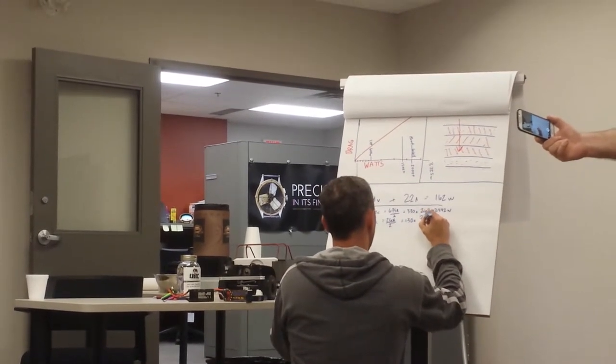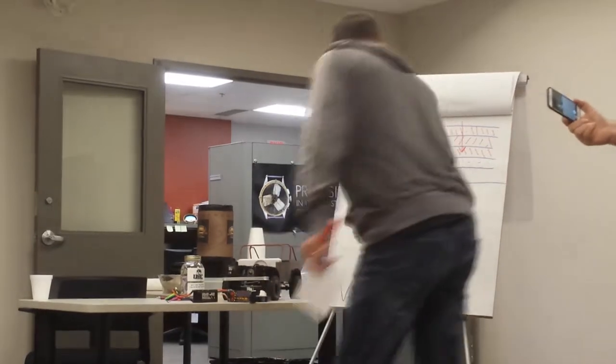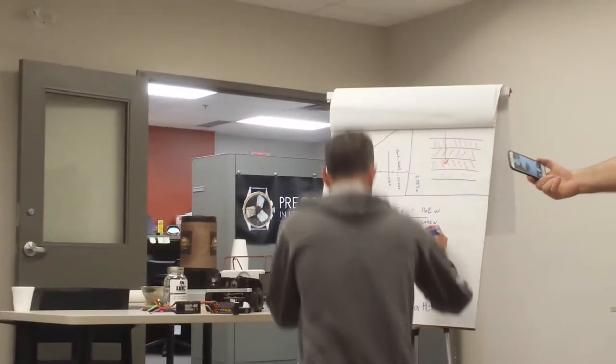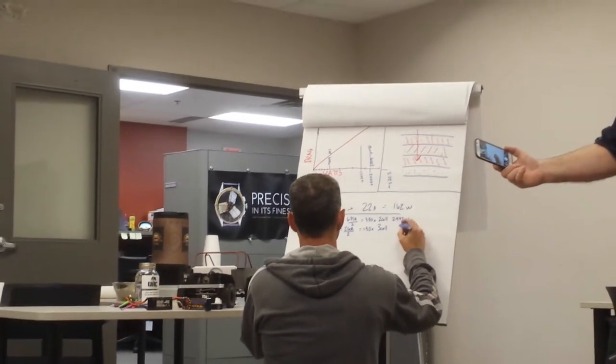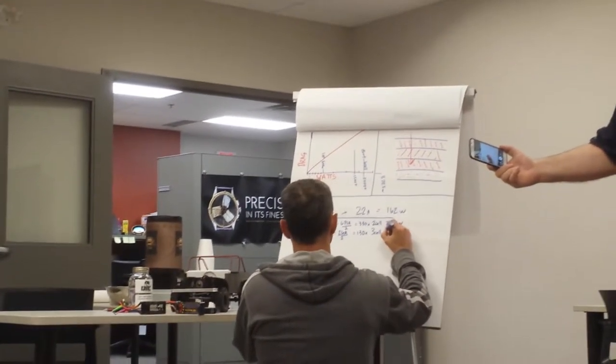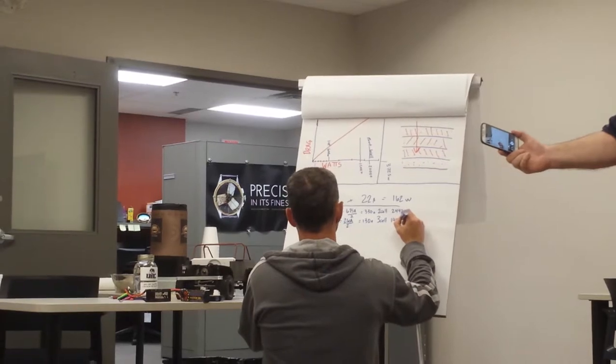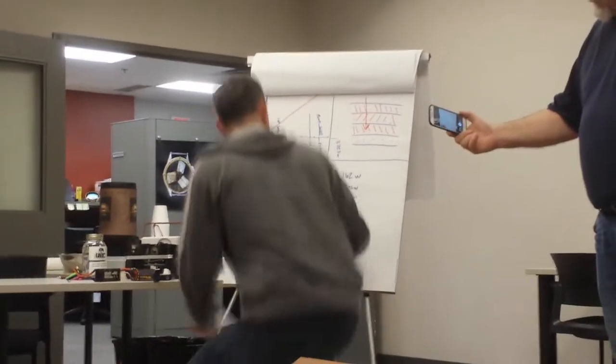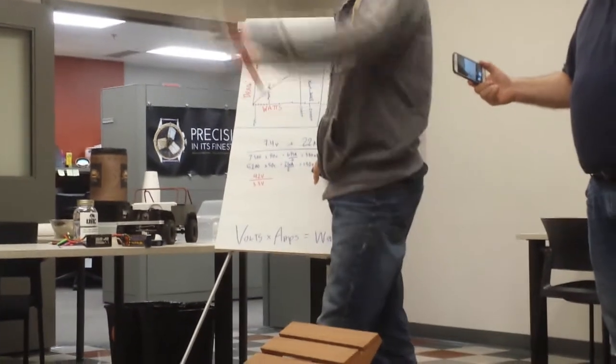It's a three-cell battery, so if we take the three-cell voltage instead of two and put that into the amp math, we end up with a battery that can actually put out 1,443 watts, okay? So what happens if we have a six-cell truck now, like a Big Yeti?